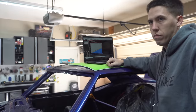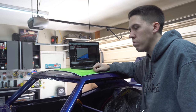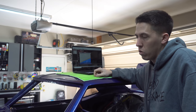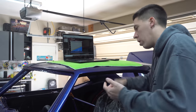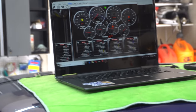I have a manual gauge I can bring over and tee into one of the turbos and just check it. Yeah, for sure. It's just weird that the sensor doesn't even act like a normal sensor. Right. We can give it some throttle and stuff, but if it just plateaus right there, it's not right. It's like hitting a wall, that makes sense. We're good? Yep. Go for it.